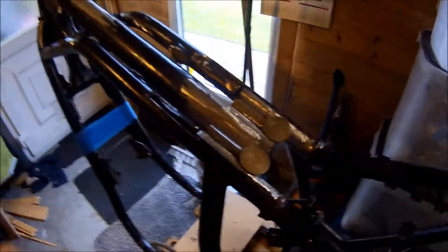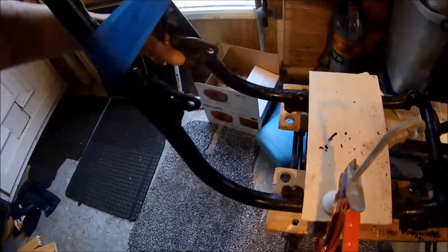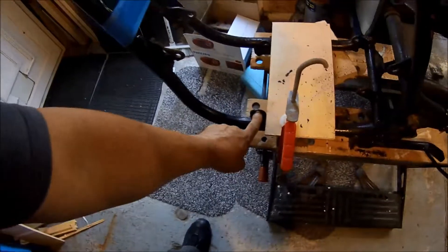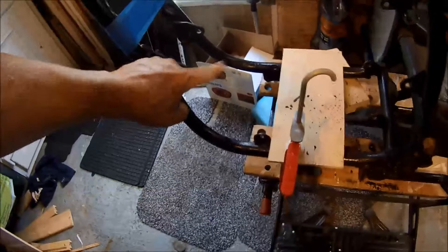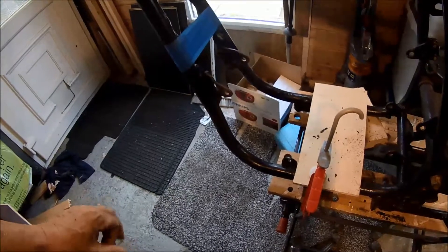Like I say, I'm not doing it today because I'm very skinful basically. I've worked out that's the way the clamps go. I've measured the distance on the dummy engine from here to here - 205mm - so that's the right way down. That's the right distance, 100mm between them, and that's a match for the 500 engine.